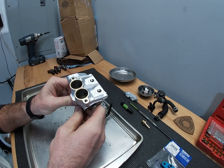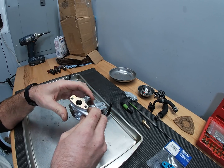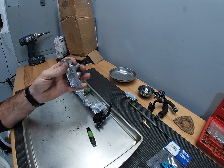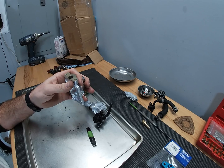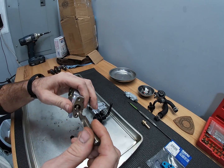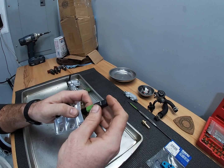Now we've got our primary injector fuel rail out. I'm gonna move to where I have the vise and we're just gonna tap this out and put threads in it. Normally when you're tapping something out you would need to drill it first, and for quarter inch NPT it calls for a 7/16 drill bit, but this does not need that so you can just go straight into it.